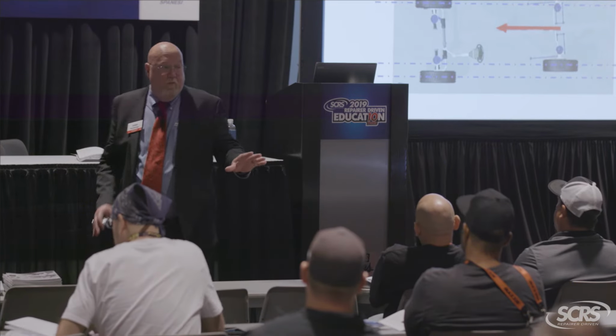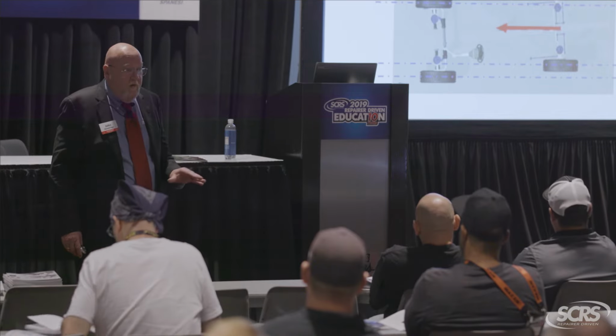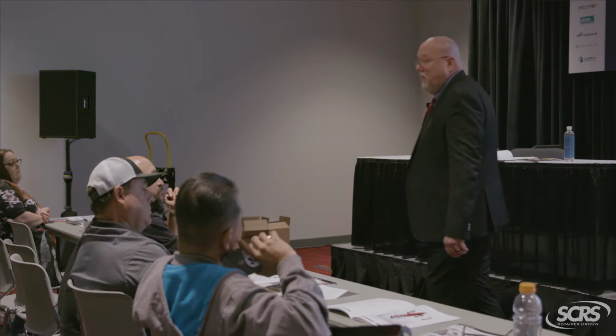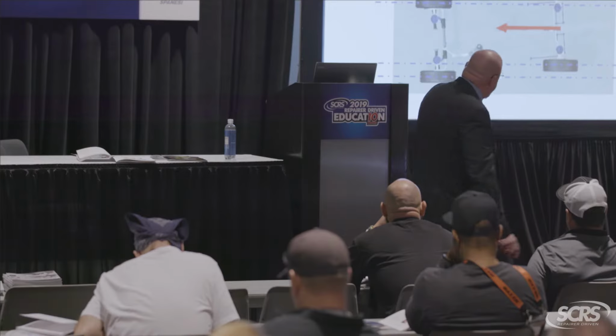Now, that's great for the maintenance shops that do corrective and do maintenance alignment, and even for the modified guys. But for the collision repair side, I'm sticking with what everybody else says. I want to see a real scan tool hooked to that car. Because I'm going to tell you straight up, CodeLink is not a scan tool. It's only a device that does alignments, calibrations, and adjustments. It'll read codes, and it'll clear some codes after the repair has been made. So that would be your after-alignment thing. Never ever clear a code before the repair has been made, right? Okay.